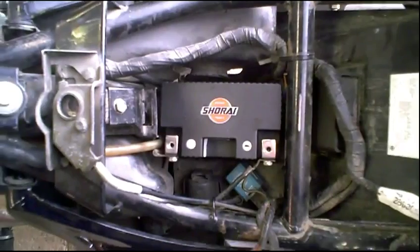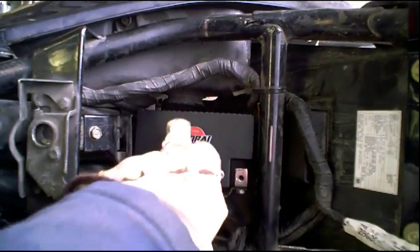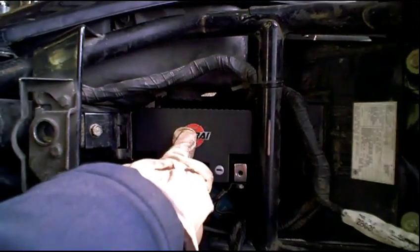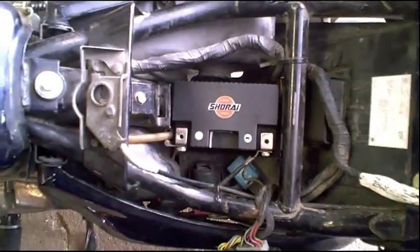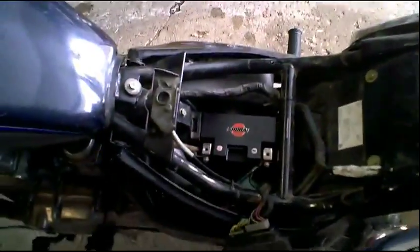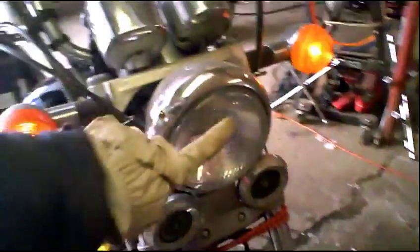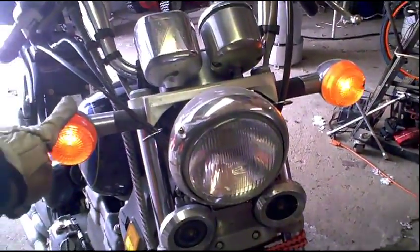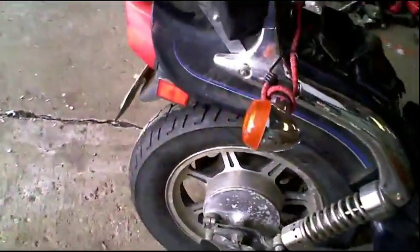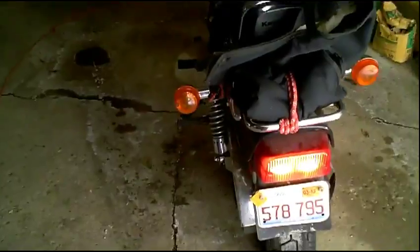Okay, battery is installed. When I do finally put everything back together — if I decide to keep this battery in the bike — I will put a piece of foam there so that it fits properly. All dimensions are fine except it just needs to be slightly taller, and they give you pieces of foam to make that up. Right now I've got it tightened down in place. They also say in cold weather to turn your bike on and give it 30 seconds with the headlight on. Unfortunately, the way my bike is wired, until the engine starts running it keeps the headlight off. So I can leave it on for about 30 seconds with the running lights on and hopefully that will give the battery a little boost.